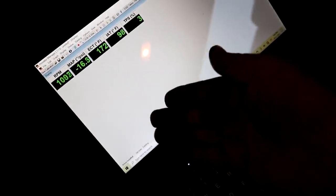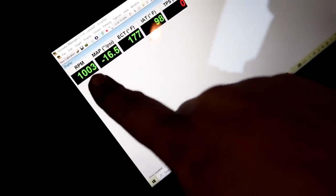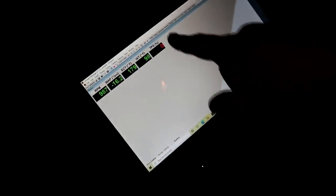Our TPS is also reading 3. I adjusted it up, which makes the TPS read, so we've got to make sure that the ECU knows it's at idle. We're going to go back to TPS, read the minimum reading with foot off the gas, and upload. It's not as shaky now because it's actually in idle mode and it dropped to around 950 to 1,000, which is right where I'm shooting for. Our air fuel also got closer. If the TPS is reading more than zero, it's going to cause issues with idle sometimes.